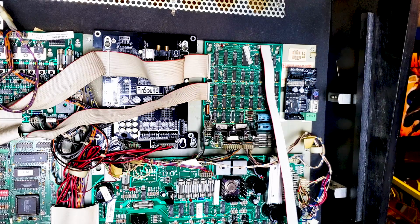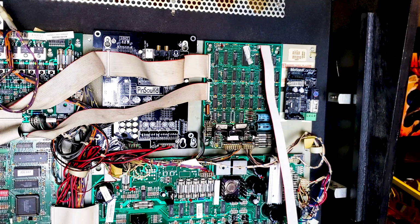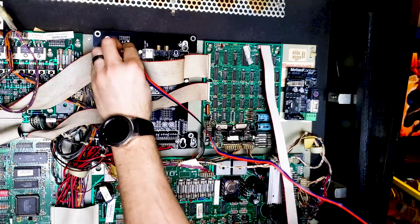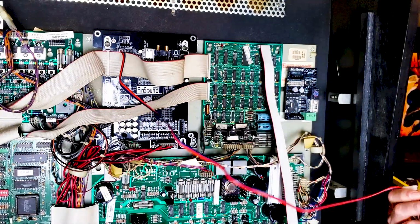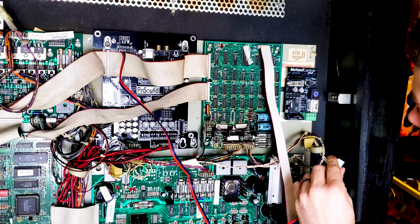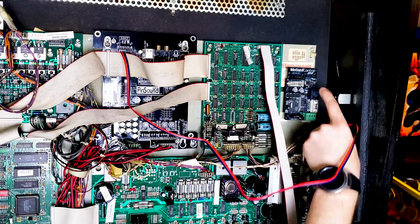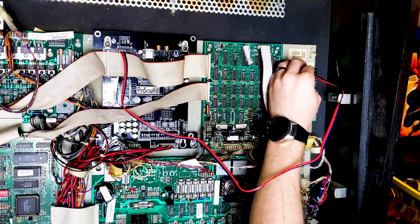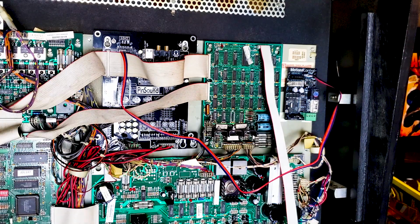Alright, inside your kit you will find multiple cables all labeled accordingly, and if you follow your instructions you will find out that EXT1 goes into the EXT1 port up here, and this says PinSound EXT1. I had to look at the instructions again. So it says PinSound EXT1. You have your EXT1, but you have an in and you have an out. This is going to be going into the in, which is the 4-pin connection that's on the left. So that puts that there.